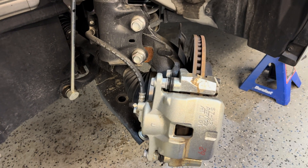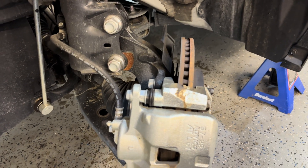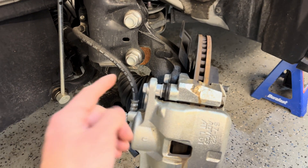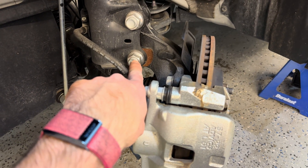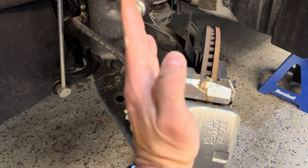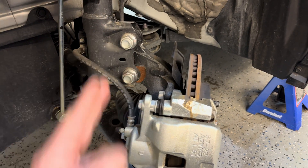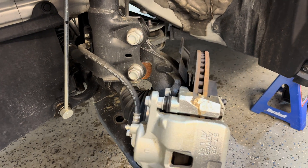It's pretty neutral here, but if for some reason you wanted to give it some negative camber for performance reasons, you could theoretically put this eccentric bolt in a different position that would allow the knuckle to tilt out a little bit, basically pointing the rotor closer to the top bolt on the strut and tilting the wheel in that direction.